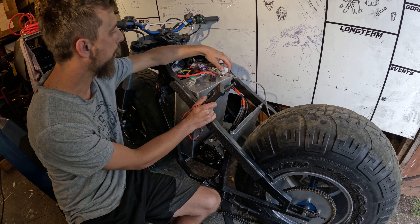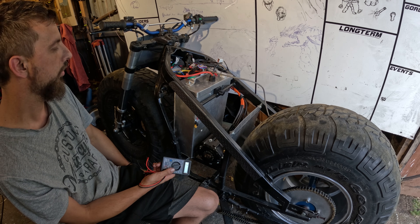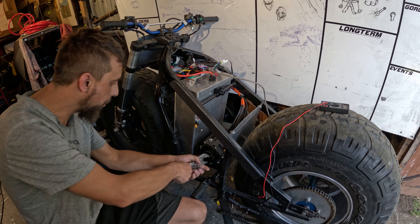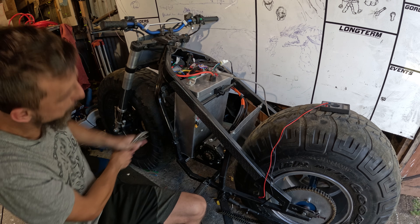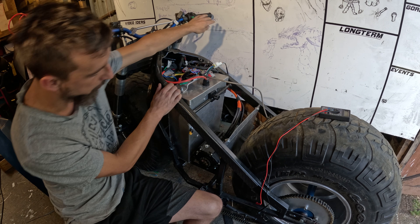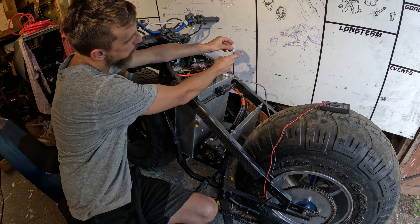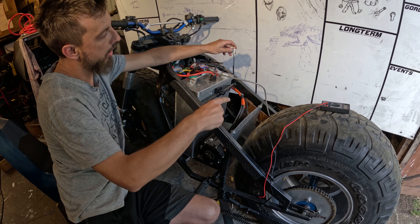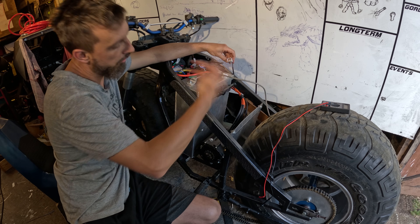This is for the hall effect sensor. The plug looks fine, there's nothing wrong with it, but now it just does the old beep beep beep trick and it won't go. I can turn the motor a little bit — it's hard to turn because it's got a gearbox. You can see the position where the hall effect sensor must be working, and then it'll flick to the next hall effect sensor. These wires go down to the motor, and there's some little sensor switches that pick up where the magnet is. As it spins around it tells which coil to fire, and that's what spins the motor.